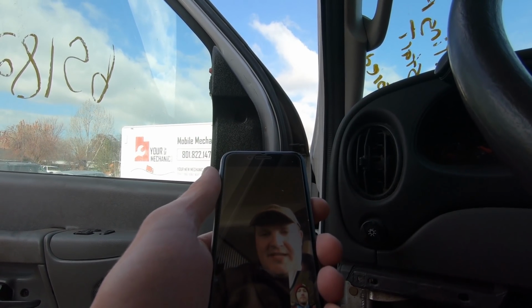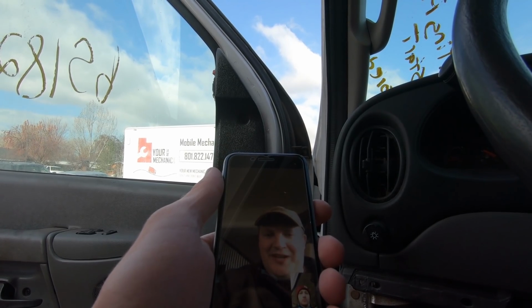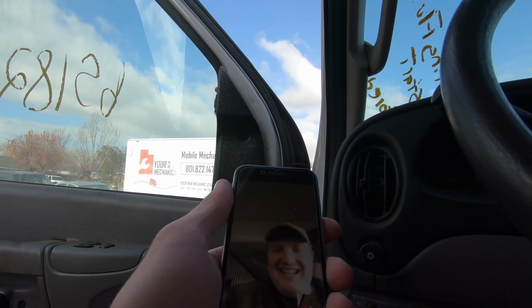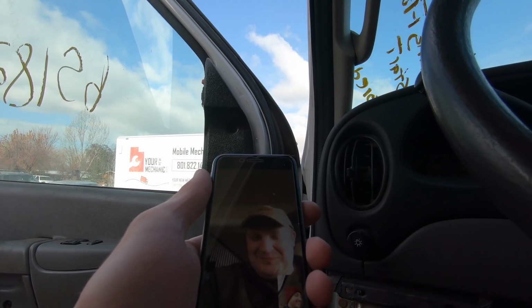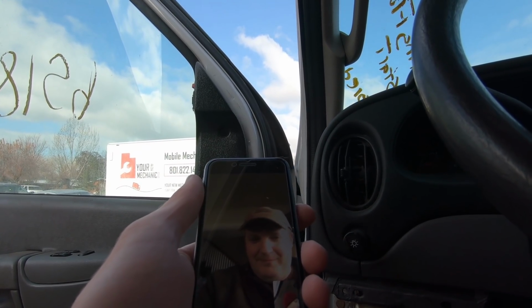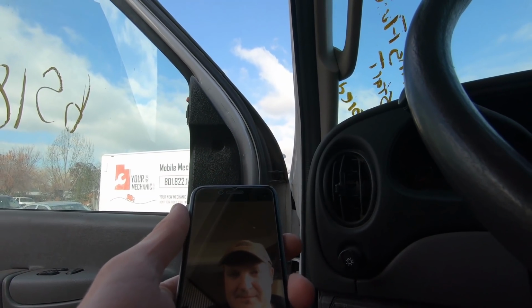Sometimes you've got valve covers off, which, being a van chassis, is not a fun job. It's pretty tight. Very tight. Yeah, that's kind of where you have to go. So hopefully it's not a leak. Hopefully it's that IPR valve.